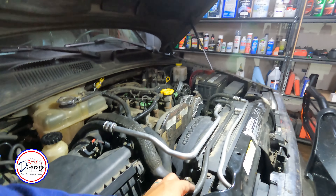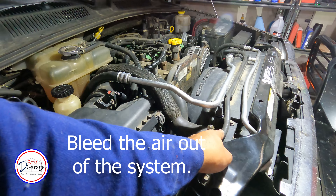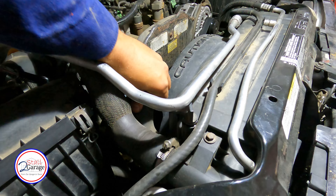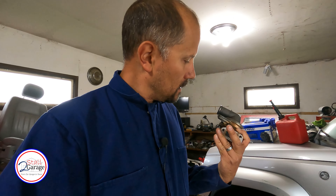There's the copper coat — you can get that at O'Reilly, online, or at Advance Auto. I spray down the gasket on the cardboard box, then spray down the thermostat face where it mates up to the gasket and where the gasket mates to the head. I put the thermostat back on with the two top bolts going through, put the thermostat gasket on, and snake it right in there between the tubes and hoses. Always put your OEM spec coolant in this — don't put any green stuff or universal coolant; that will cause corrosion in the block and potentially pitting on top of your engine block.